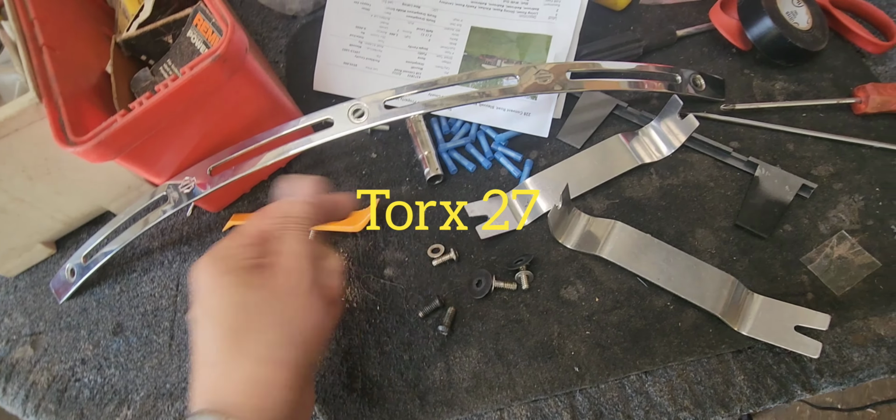So this is the bottom where the silver trim was. That has to be removed. And this goes over, which goes on the top. So you're going to have to remove that or loosen it up. This doesn't have to come out, but it's probably easier to remove. That's actually held on along with that face headlight thing here. So once you remove this, and over here on the side, loosen that off, while removing both sides. Then remove these 3, and you should be able to remove the entire face plate.